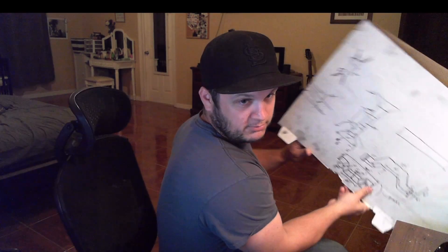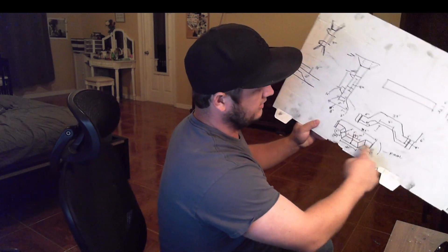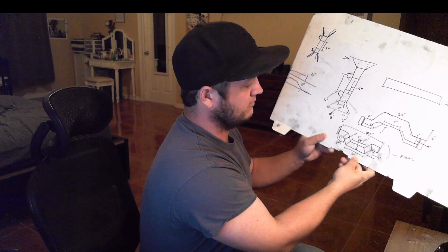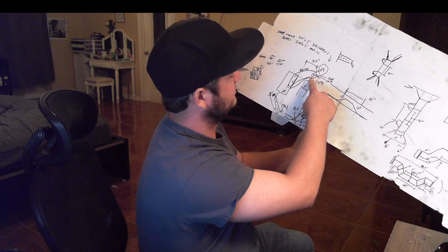I had a buddy reach out — he had an old work truck take a dump on him and he wants my help building some parts to make his old work truck into a sleeper race truck. He's got a hookup on NASCAR parts, so he wants me to use the plasma table and model some parts. On this ultra professional piece of cardboard, we got an idea of what he wanted: the crossmember out of 4x4 box tube, some flanges to box in the C-channel frame, tabs for the link arms to the rear end, shock mounts, and a panhard bar mount. I'm going to model all of it in Fusion 360, come up with some flat patterns and cut profiles.